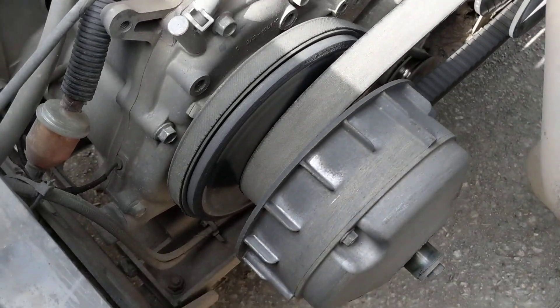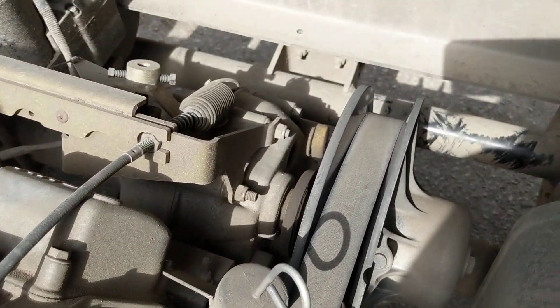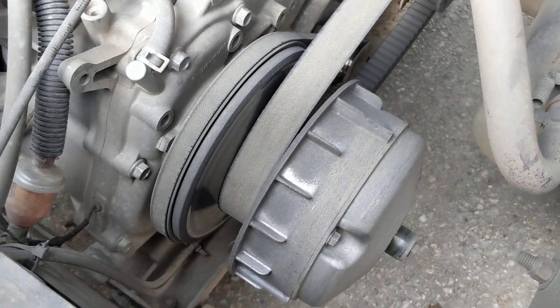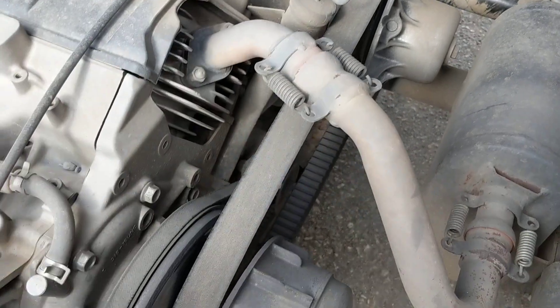You can see as this pulley pulls together and makes the drive sheave larger, that one separates and gets smaller, which acts as an ingenious method of converting one RPM coming out of the engine to a different torque value between the two pulleys.